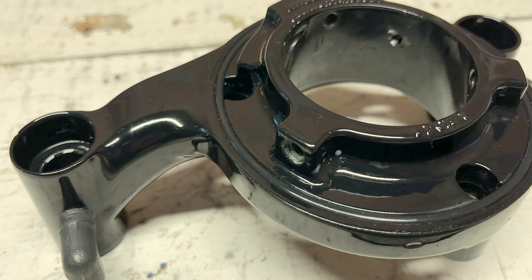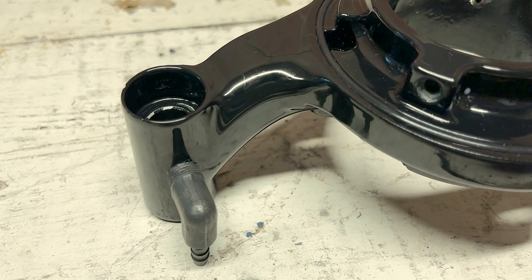I'm not an expert on these motors — I'm just trying to learn as I go and share those learnings with you along the way. It sounds as though the issue has to do with over-oiling of the cylinders, and that vacuum being present in the crankcase helps to pull the oil down on those cylinder walls to alleviate that issue. From comments by viewers, by adding the external breather modification to the Arlen Ness intake I may have removed the source that would add vacuum to the crankcase.